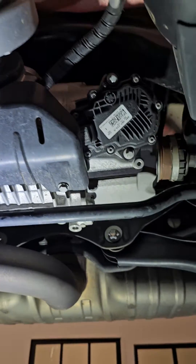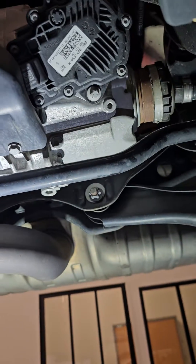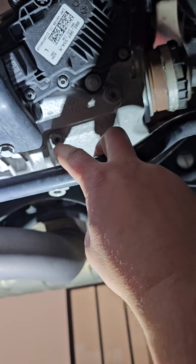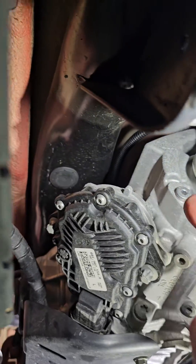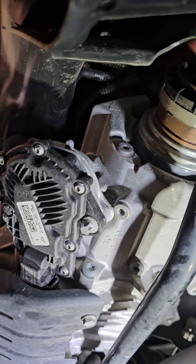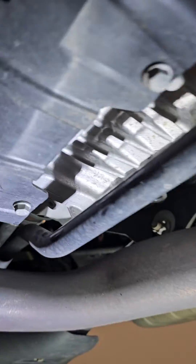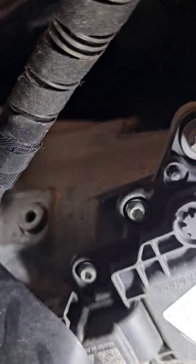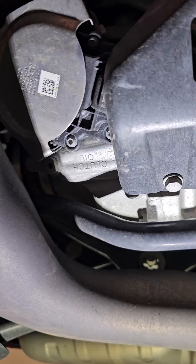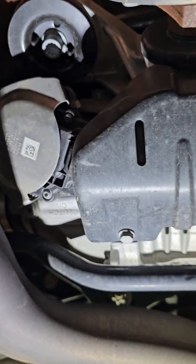So I'll have a look. You have three compartments to drain. This is the drain bolt for the left clutch pack, and then you have the fill plug just there. The center diff is this one, and then you have the fill plug — probably in the middle — so yeah, this should be the fill plug for the center diff. There you go. And then on the right side, just a similar thing: drain plug, and then you have the fill plug up top.